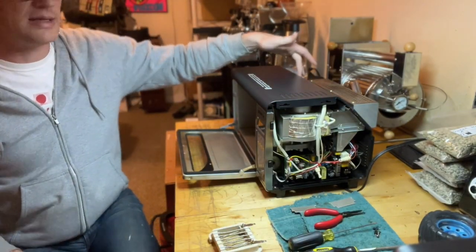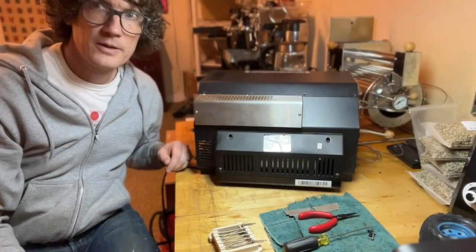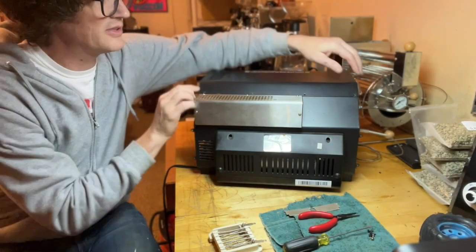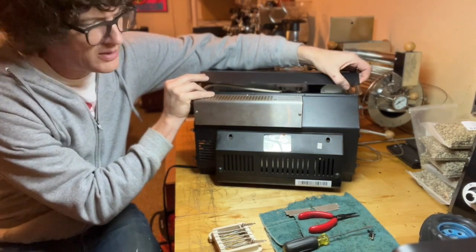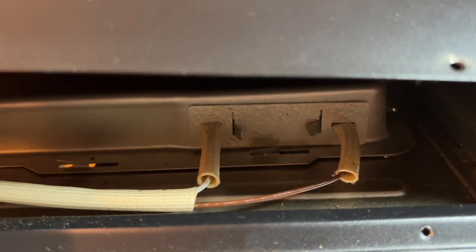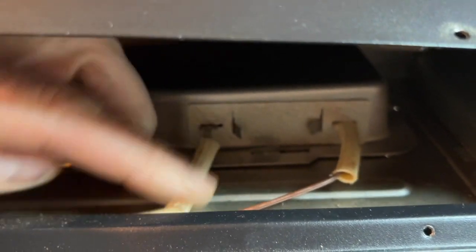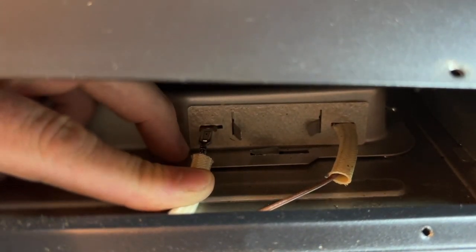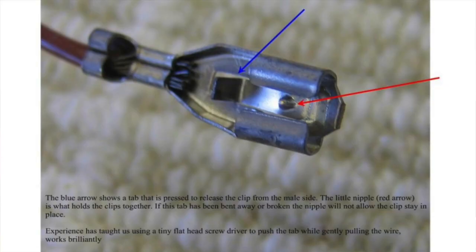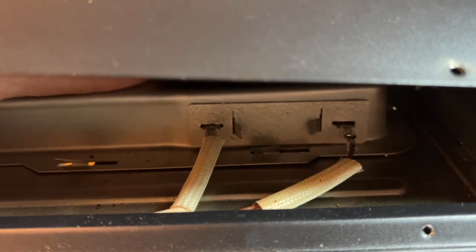Now I'm going to remove the four screws on the top back of the machine. With the screws out, you can lift up the back panel, but you don't want to lift it off altogether — it's connected in the front. You just want about an inch and a half of clearance to access those spade clips. You need to pull these little sheaths back in order to gain access to the spade clips. The spade clips have a little tab that needs to be depressed — you depress the tab and then pull them out. I'll do it off camera so I can see a little better with some lights, then pull both back and undo those clips.